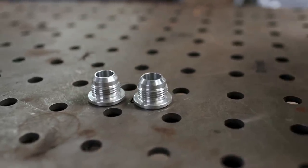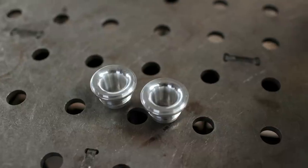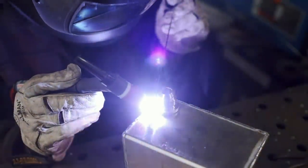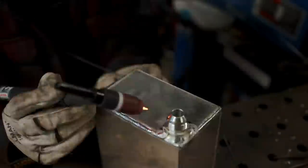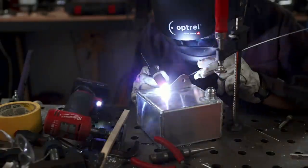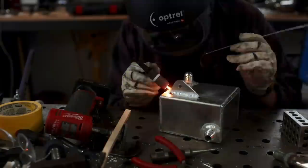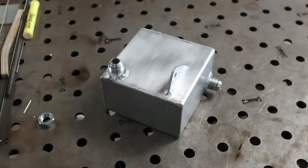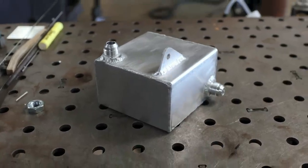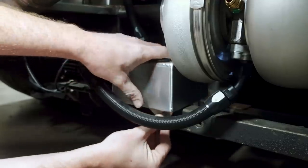Now we need to add that inlet and outlet to our metal tank, and I'm using Vibrant Performance weld-on AN fittings. I like these a lot because they have a really nice filleted edge on the backside that allows for really solid flow characteristics over a lot of the other ones I've used in the past. They've also got a nice machine register on the backside, which makes locating them in a hole nice and simple. We just had to punch some one-inch holes into our metal box and weld the whole thing together. The last piece of the puzzle is welding on a mount so we can attach it to that chassis rail underneath the turbo. Overall, I'm really happy with how this box turned out — Scotch-briting the surface has it looking pretty good, and it has me eager to build even more with aluminum. This thing fit perfectly into place and our bolt holes lined up.